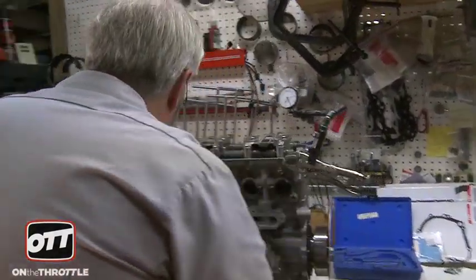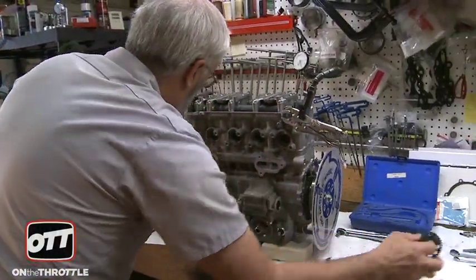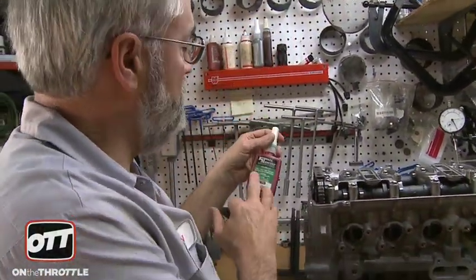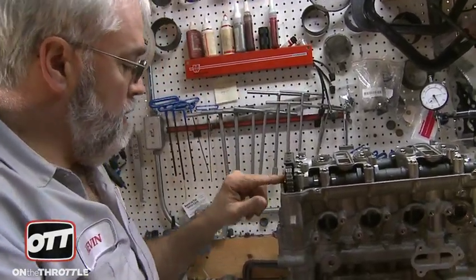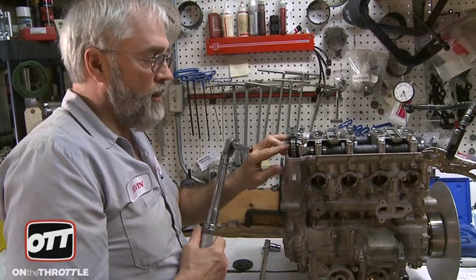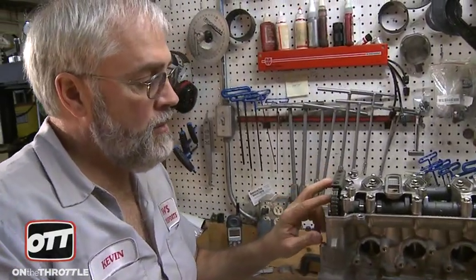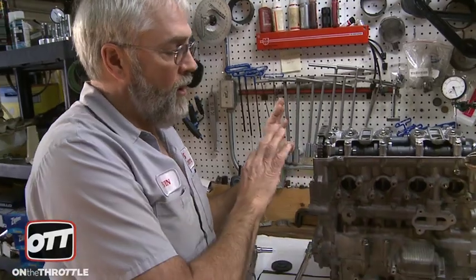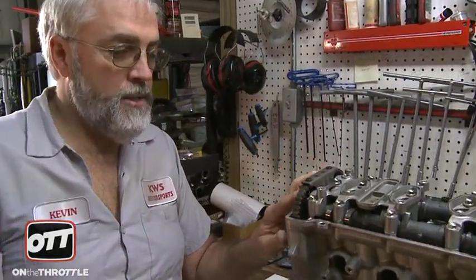When you're done making your adjustments, on the side where the sprocket is, you should put blue Loctite — a small amount — on the bolts when they're out and then torque them. In this particular sprocket set, these go to 20 foot pounds. Check the manufacturer's manual — that's something we use constantly at the shop. If there's any deviation from that, always consult the manual or the manufacturer of the sprocket.